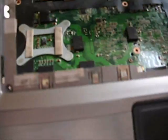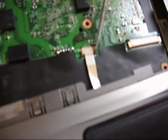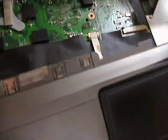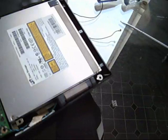I took all the screws out of this and it lifted up. There was another ribbon card under here for the mouse. I took a screwdriver and pushed these little brown pieces down to pull the ribbon out, and that popped right off. I cleaned that all out too.